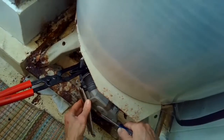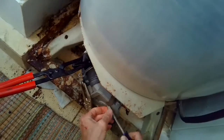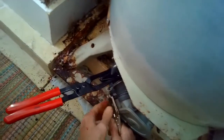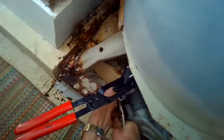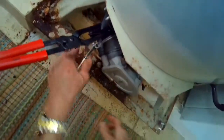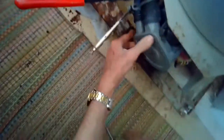There are two clips in front that we just pry off using a standard head screwdriver. Just pry them up and then you can pull the water pump right off of the motor shaft. If it's been rusted on there for a while it might be hard to get off — you may need to wiggle it or put a screwdriver behind it to pry it off. This one luckily came right off.